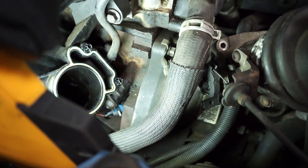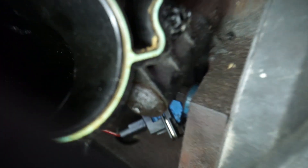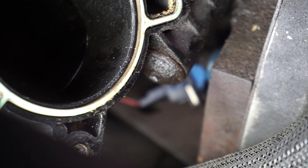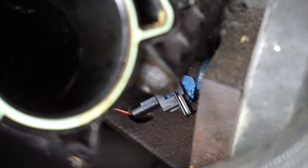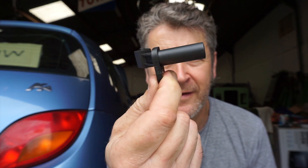I'll show you where this sensor is buried. We've already taken the throttle body out of the way — it's right under the manifold, buried down here. The plug is right down there. It looks like just a little 8mm bolt. We'll pop the new sensor in and hopefully this will work. The simple job of getting the crankshaft sensor out was not so simple.